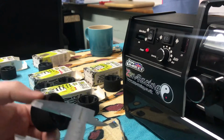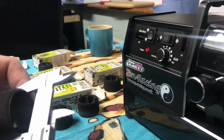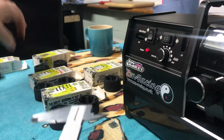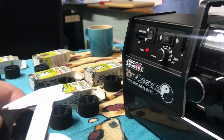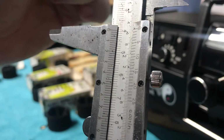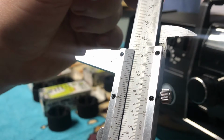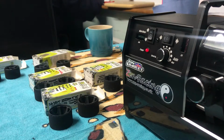and then I'll go through the fronts. Now, because I know that I want a stagger of 2mm, I can measure the front, and I go through, and again, that one's bigger, that one's about the same, that one's about the same. Yeah, so the smallest front tyre is, what's that, 40 point, probably 39.85, something like that.